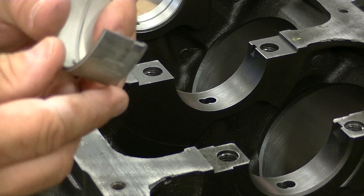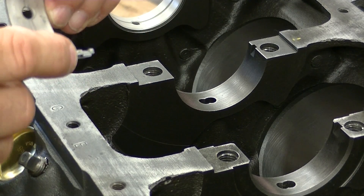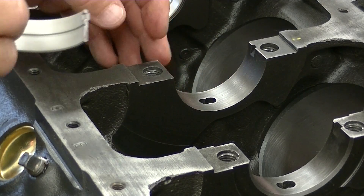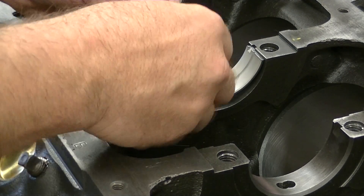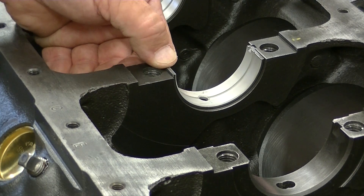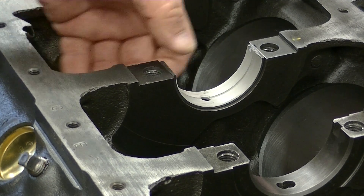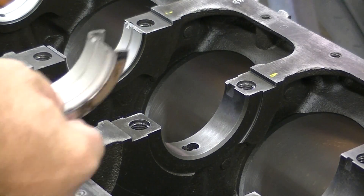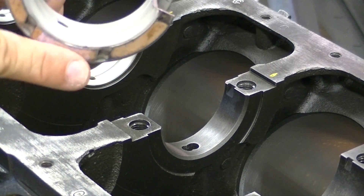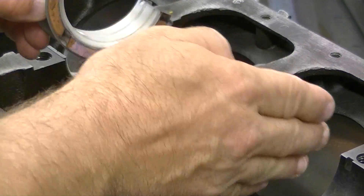Along with any other engine, you're going to have notches. You see that notch there on the bearing? On the bearing cap. On the block itself, what you'll do is match that and just push down until it's flush on both sides. On our number three bearing we have the thrust bearing, and there's thrust plating on the sides for the crank moving back and forth.